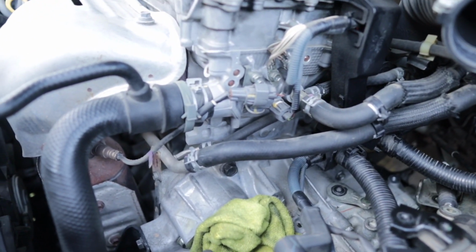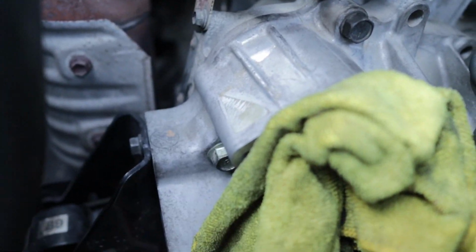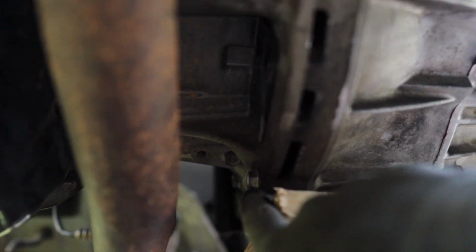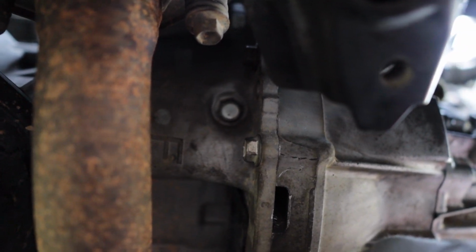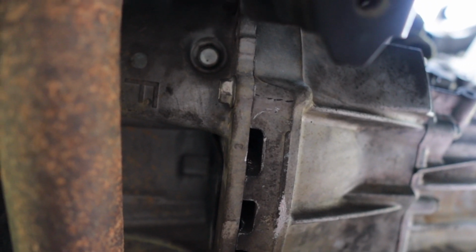This one's a different size. I believe it's a 16 or a 17. And check that one and that one. Those are different sizes. There's another one at the bottom, and there's some behind that you connect from the back, so from underneath. Right there, guys. I'm not sure if you can see it. Right here. There's one right here. So you're technically connecting the engine into the transmission from behind. So take those off. Should be good. And yeah, let's get it going.